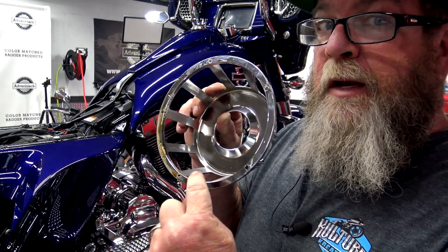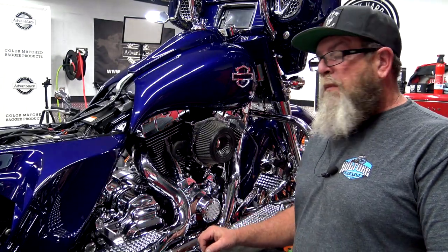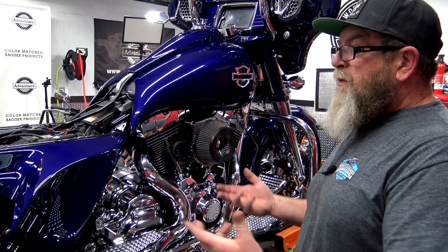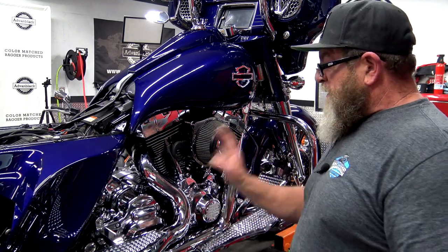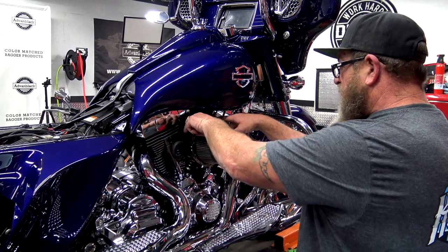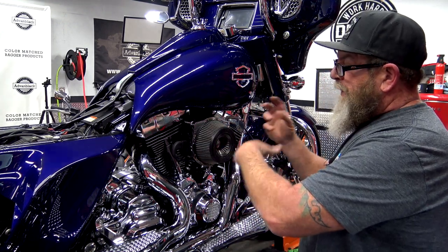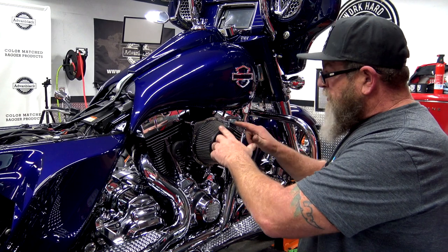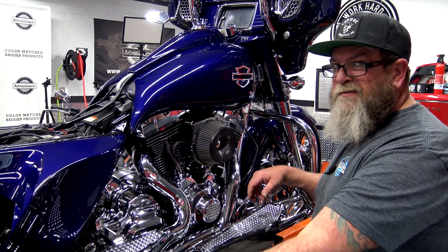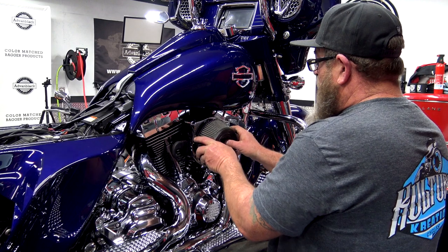Looks like we got some forbidden honey in here — a little bit of blow-by on this bike. If you see that oil, don't freak out, it's called blow-by. These banjo bolts right here are designed to do that, so it's okay. If you're riding your bike and it's super hot and you get home and you've got some oil sprayed down, it's because you got blow-by. The banjo bolts that come out of the top and come into here are supposed to feed that blow-by back into the air cleaner to get burnt — but it doesn't get burnt that well, as you can see, because there's oil all over the frame.